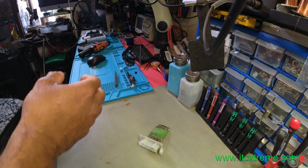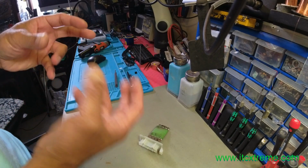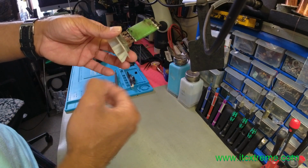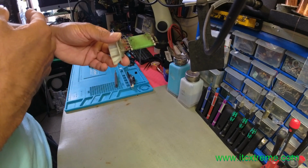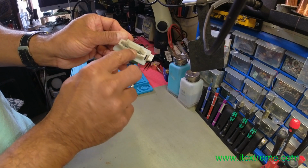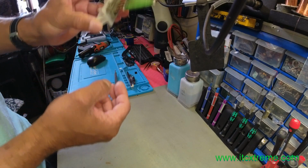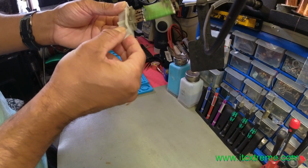When you take the fan out and look a little bit deeper, you will see the actual resistor. There is a harness going, and again you've got to look underneath it. The harness is on the outer side of the fan housing, and this is the connection. It's a 4-pin connection, a very awkward one. When you look at it, you think you'll click onto this and then pull out, but it doesn't pull out that easily because it is held by these little things as well.